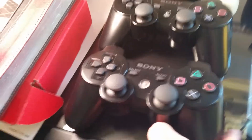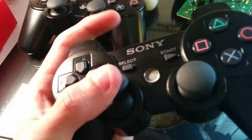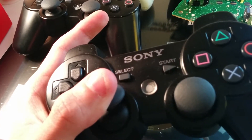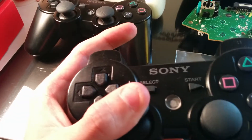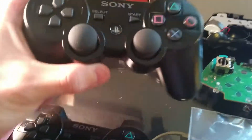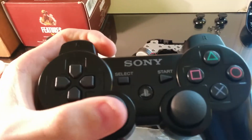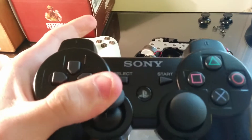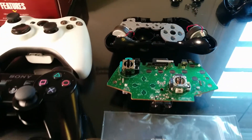Here is an older 6-axis controller shipped with the original PS3. As you can see here, the click is fine, but too many years of Call of Duty — when you push forward and try to run as you would in that game, or hit L3, it's kind of difficult to push. I know it still sounds clicky, but it's uncomfortably hard to push. So I replaced this in a DualShock 3 controller, it was the same way. This is the new module, and this has been done for about two years now, and it feels a lot more comfortable. So I can do this repair in PS3 and Xbox 360 controllers — they're the only ones that I've experimented with.